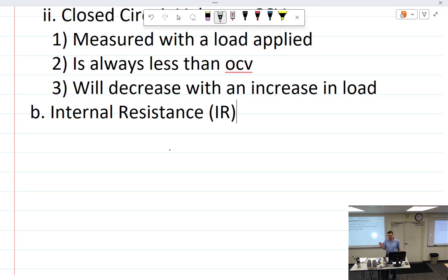So as a dead battery, when you go to 14 volts, because of that voltage and Ohm's law and low resistance, a lot of amps flow, right? Because that's Ohm's law. And so as the battery starts to charge up, the voltage is locked, the amperage starts to come down. The battery's filling up and the amperage comes down, down, down. So if you look at it that way, you'd say, oh, wait a minute. If it's a dead battery and I put 14 volts in, I get a lot of amps. Ohm's law says that that would be high or low resistance? Low. And as it starts charging, then the resistance must go up to limit the current.